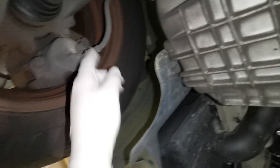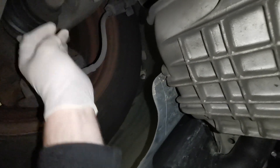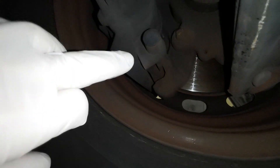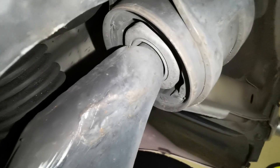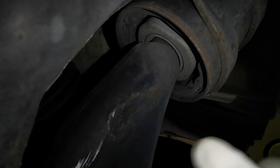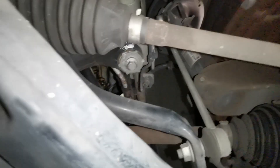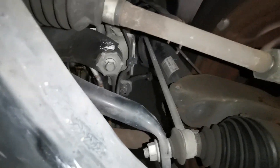I had checked it before I bought it, but with each service I go over the brake lines and CV boots. I'll be taking the wheels off, but you can sometimes see how much pad is left on the inner one depending on your brake setup. You can check the wishbone condition with a pry bar to see if there's much movement in the bush, and also check your drop links and anti-roll bar bushes. You can give a very detailed inspection even without a lot of clearance.